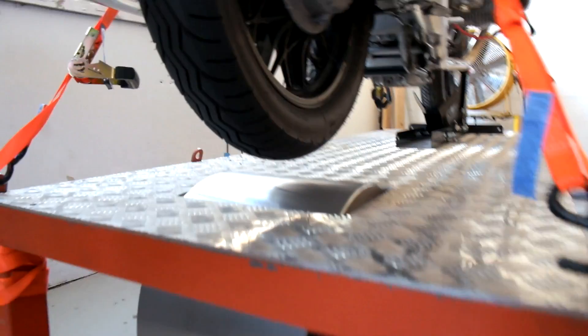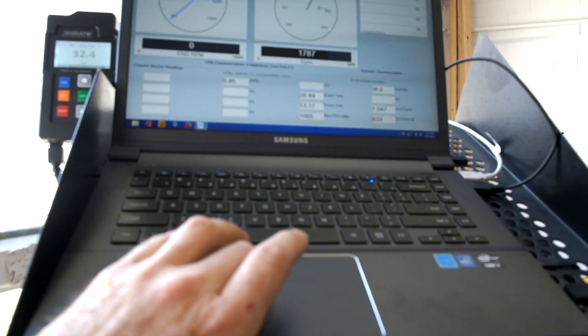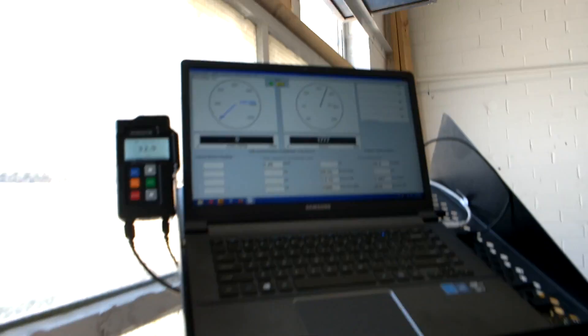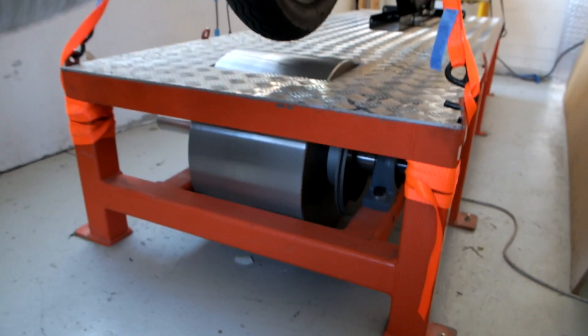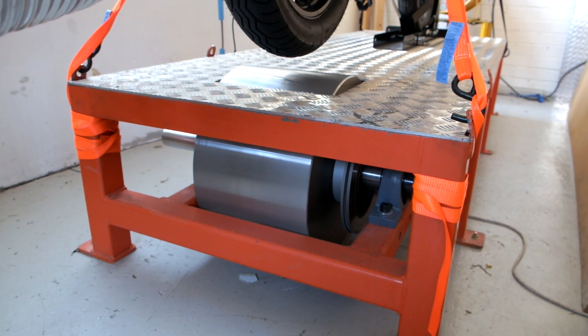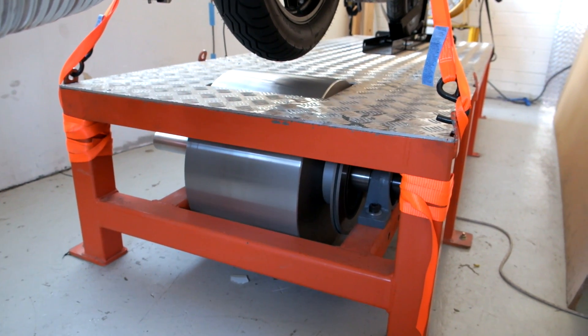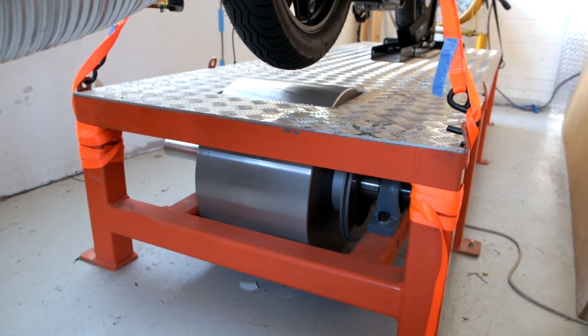Touch wood. You can see the wheels are nicely off the dyno wheel. I've got about 1800 RPM. I've got to hit the start button for the coast down test and then wait around 20 minutes — it takes about 20 minutes for this thing to coast down. Then the software will be hit again and automatically calculate friction in the wheel, the windage, the drum, the bearings and all that sort of stuff, and incorporate it into future dyno runs. So that's a wonderful thing.